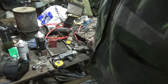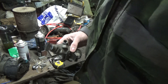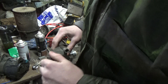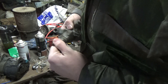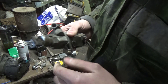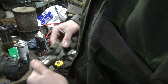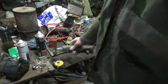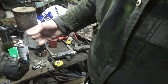You're asking: why on earth are you not just using this one? It's the correct one for the job. Well, a couple of reasons. One, the steering column lock has seized up solid. Two, the ignition key is stuck in there solid — I've had mole grips on this and I promise you it is in there. Number three, if you feel the switch positions it's pretty much worn out, whereas this one has a nice firm click with each position. So I'm going to take that top plate off and start the modification process to fit this back onto that switch.